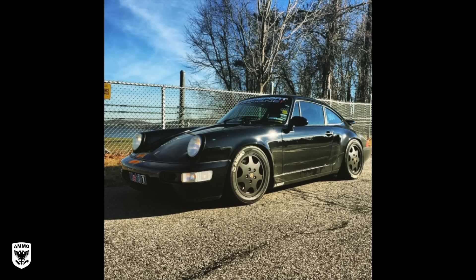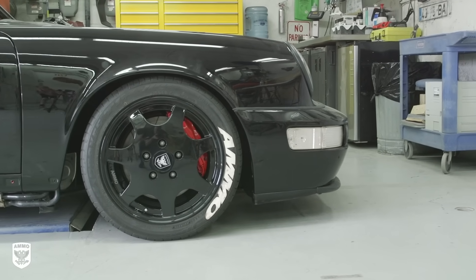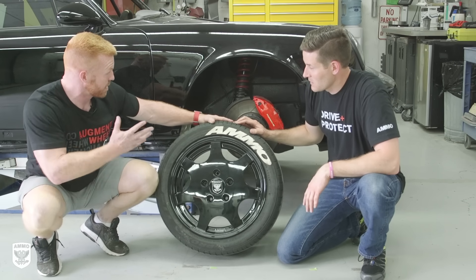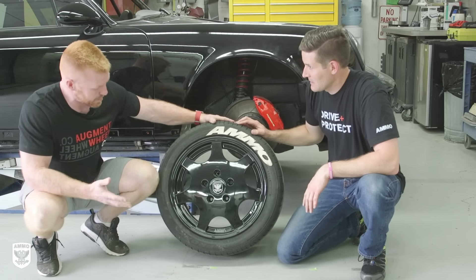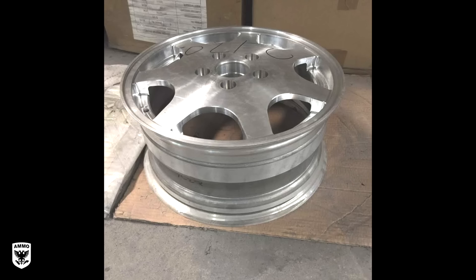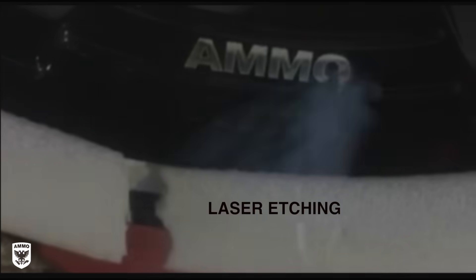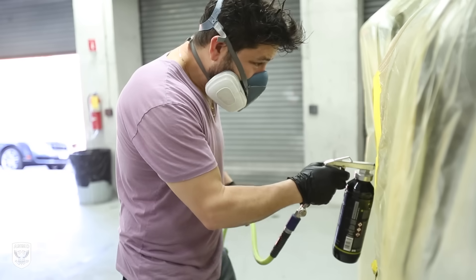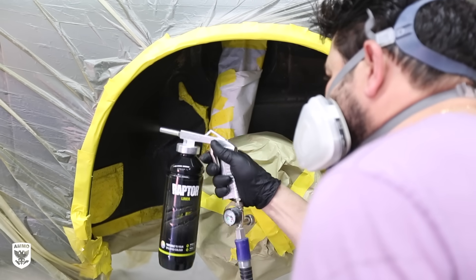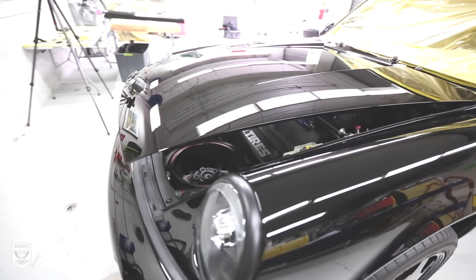Then one of my longest projects arrived from Canada — the custom 17-inch Design 90 wheels, originally designed for the Porsche but only available in the 16-inch size. Since I installed the 965 big brake kit, the 16-inch rims don't fit over the huge calipers anymore. I contacted my buddy Dan Pie from the Augmented Wheel Company, and the challenge was to make a D90 wheel fit over big reds — stronger, lighter, and more modern. The result: probably the first of its kind in the world, a 17-inch forged 6061-T6 Porsche D90. I only wanted to do this if the wheel was 100% accurate, especially regarding the degree of concavity of both front and rear wheels. George then added a thick coat of raptor liner to the fender walls to protect the frame and create a clean backdrop for the big red brakes.